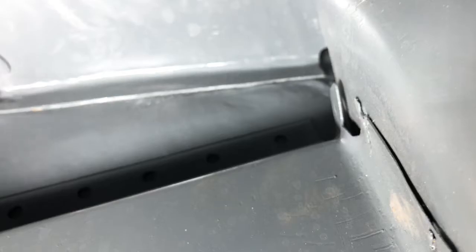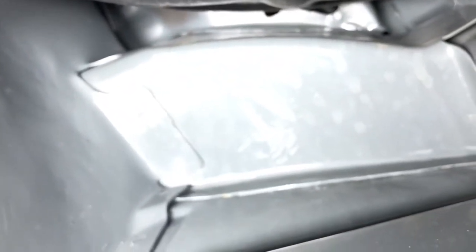You can still see the holes where I was planning on spot welding it. And this floor - I didn't finish hammering down, because up here this was all pushed in, and I managed to get all this hammered out again. I don't know if I mentioned to you that this still needs to be finished spot welding - it's in there, just not how it should be. When I decided I was going to sell this, I painted over everything so everything's rust-proofed. I've used welder primer on all the welds and everything, so there shouldn't be any issues with corrosion.